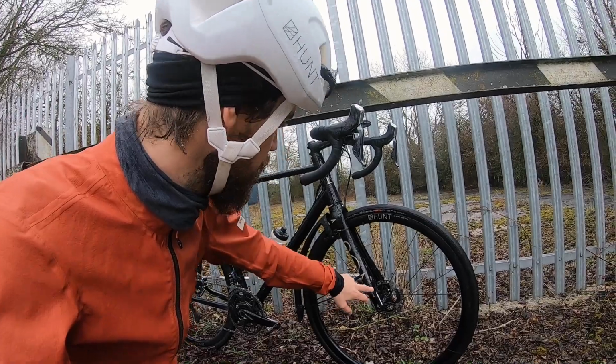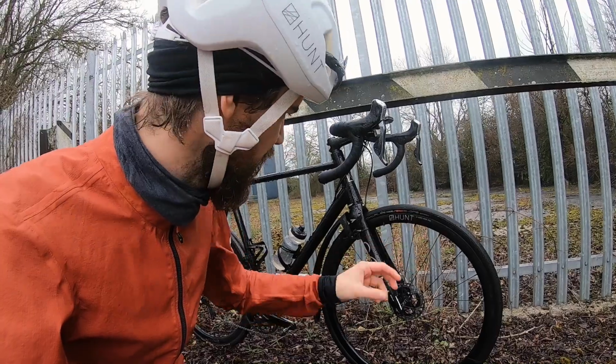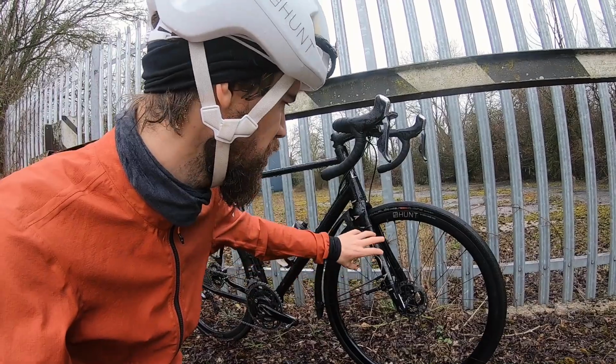They just go on with rubber straps. I have lost a couple of straps to the front one, but on the rear one you can see that they're really easy. It takes 2 minutes to put them on. On the front I just use zip ties and they don't budge. All you need to be aware of is it's worth putting a bit of tape on, because they don't move, but there's vibration, so you can slightly scuff the paintwork on the frame, which shows up on a high gloss finish.